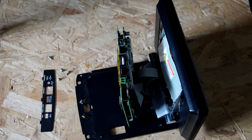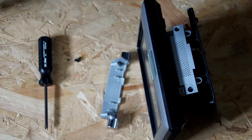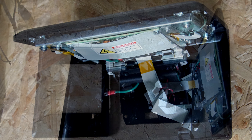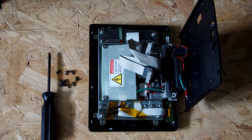There's the first bit of electronics off the metal base plate. The next thing is to take the screen to bits, so you unplug it — that's just to show the bits you unplug, maybe some useful bits there for people. Take out the two screws from the long holes, not the closer ones together — that takes the chrome bits off which are part of the hinge. Then the back plastic of the screen comes off — that was more brute force and ignorance, from what I remember.